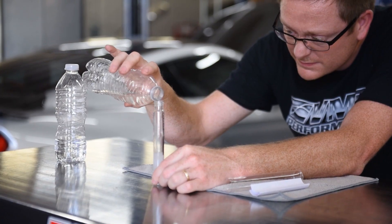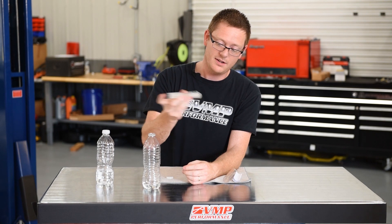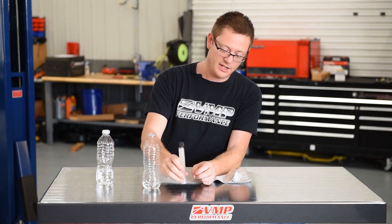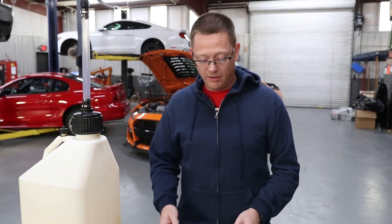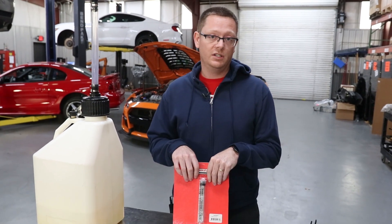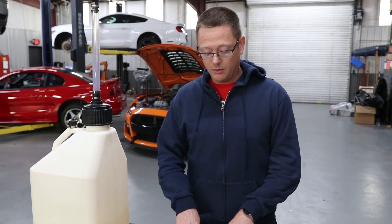That moves us on to the fuel tester. This covers two things, but most importantly for you guys that live in states that have winter blend E85 — it sometimes isn't E85. It sometimes is E70, E75, E60. I've even seen E50. The importance of using this is that when you go into a station and fill up you should probably test the fuel coming out of the pump so you know the alcohol content, because if you have an E85 tune and you run it on E50 in a boosted application you might have a bad day. Usually if you have an E85 tune and it tests out at E70 it's not a big deal unless you're running real ragged edge stuff.